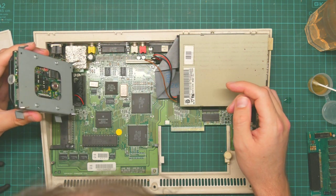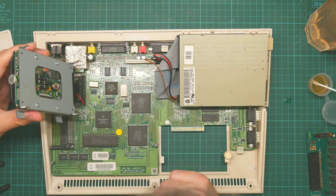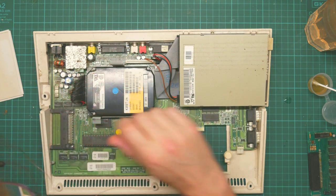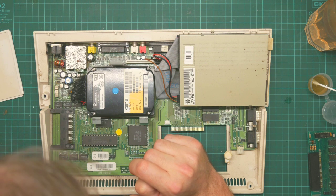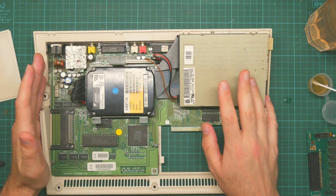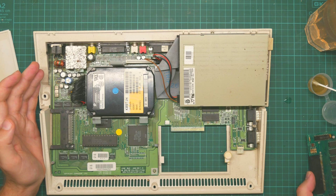It's not much in the way of capacitors. Don't see anything terribly badly wrong. I don't believe that these machines can be damaged by bad caps, though it's possible it won't work properly, but I think I'm safe to operate it without changing the capacitors. I'm going to guess that no one has recapped this board because otherwise someone would have noticed the horrible RAM expansion board.